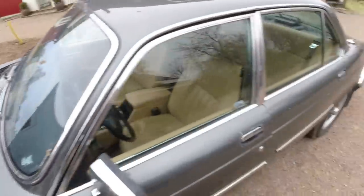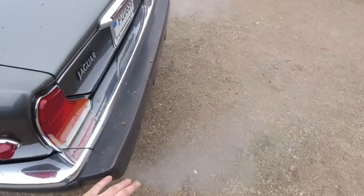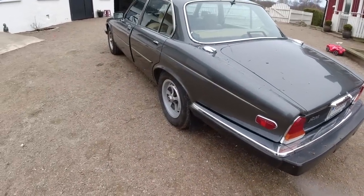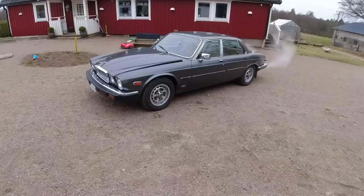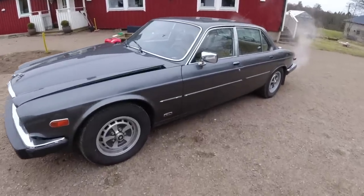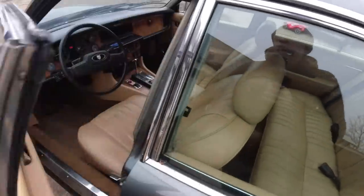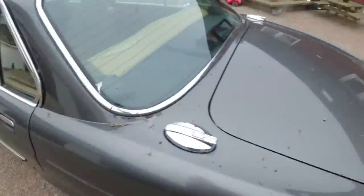It's going very well, but give it about five minutes or so and it is going to definitely change. It's been about three minutes, and as you can clearly hear, it's misfiring or running rough. It hasn't gone up to temperature yet, but the idle is coming down.